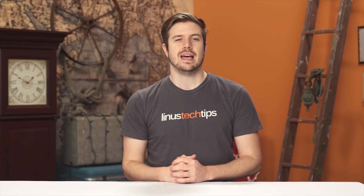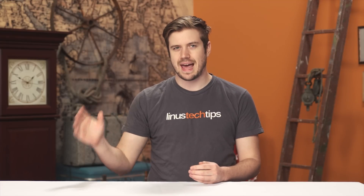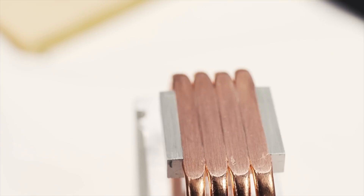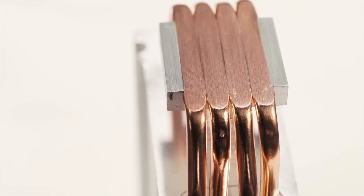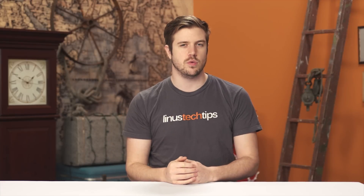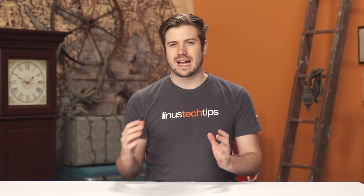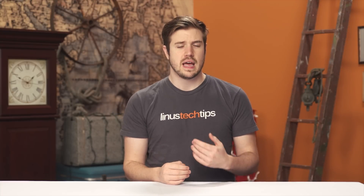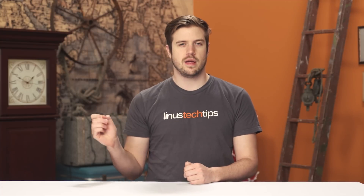CPU and heatsink lapping — that is a topic I wanted to make a workshop video on, and actually spent many hours attempting to do just that. What the heck is it? Theoretically, your heatsink has teeny tiny little grooves and nooks and edges on the surface, imperfections that will theoretically cause issues. But even worse than this, there are the curves — convex, concave, or even the sought-after lack thereof, also known simply as flat. These are all variables in the overall equation of cooling performance within your system, and some matter more than others.